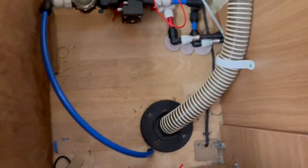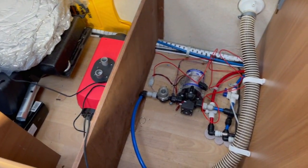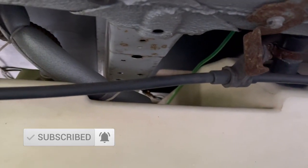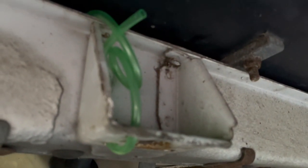The trunking will come out here. I'm debating having it blow out in two places - probably one coming out blowing towards the bedroom and one coming out in the middle, level with the original vent. The fuel pipe underneath is in position over the water tank, away from the exhaust. I'm going to cable-tie it to the chassis. It runs all the way along - you can see it. This is underneath the floor where the heater will be mounted.